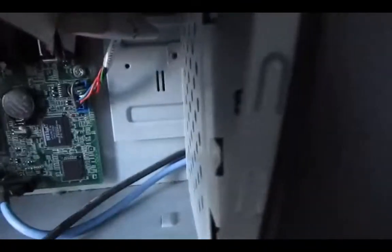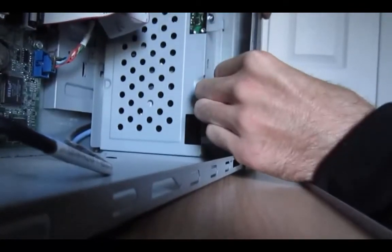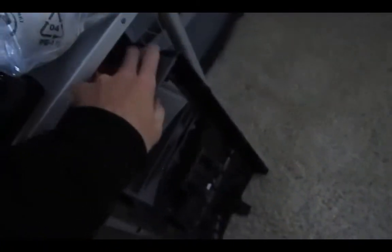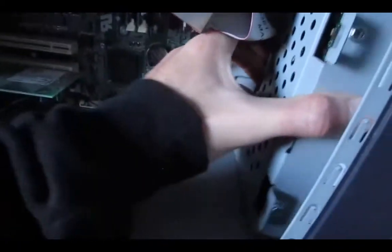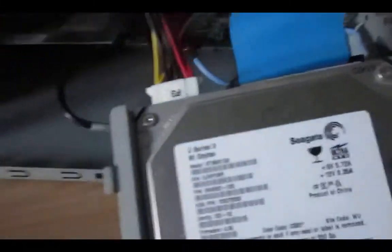There's something that requires taking off this front panel. There's a tab here, another one right here — you can't hardly see the tabs. There's one right up here. And there you go — you have access to your hard drive. There are two screws on each side and you just disconnect the cables. I'll be right back.